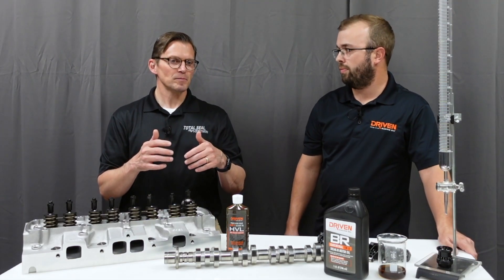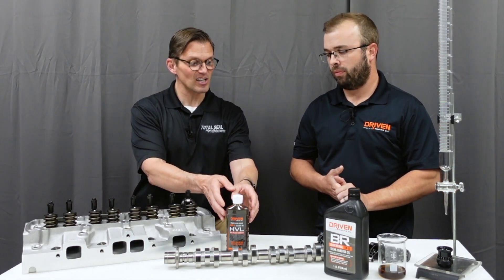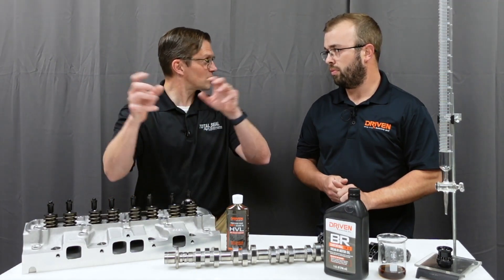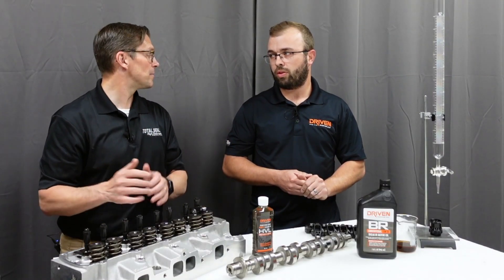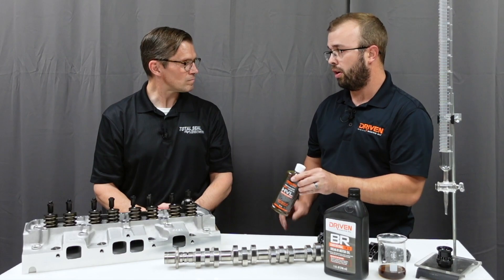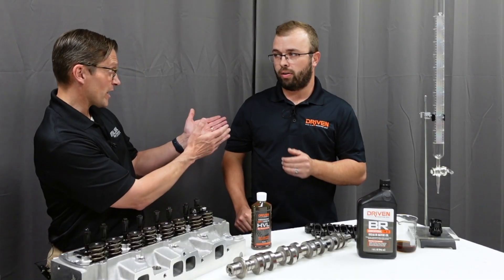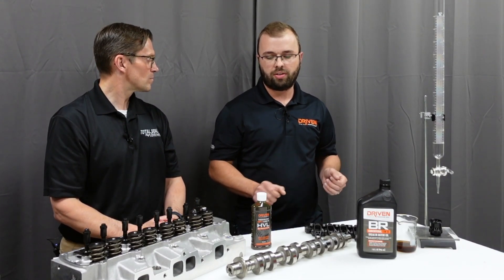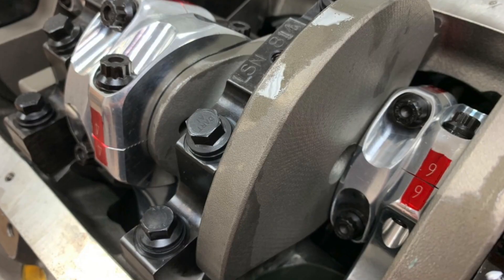You want to have the right lubrication on the cylinder wall to protect it, but you also need to have the right viscosity during that initial assembly. This whole package of lubricants wasn't just hodgepodge put together — these were actually selected and tested to do the job, and they all have a certain purpose. A lot of engine builders would like to use something like this HVL on their Babbitt bearings, rod bearings, main bearings, and cam bearings, because they're going to have a better feel by hand as they turn the motor over — compared to the assembly grease, which is going to have a little bit of drag where if something's catching, you can't quite tell what it is. Engine builders love to have that feel by hand as they're turning the motor over and assembling each rod assembly to the crankshaft.